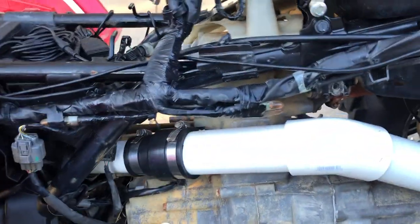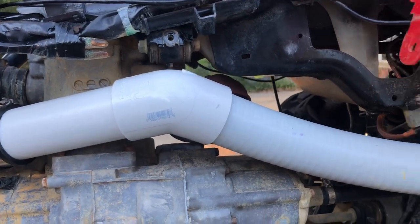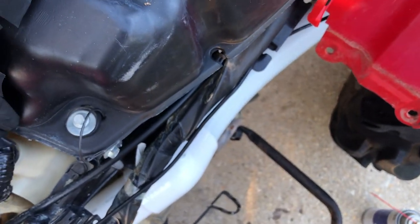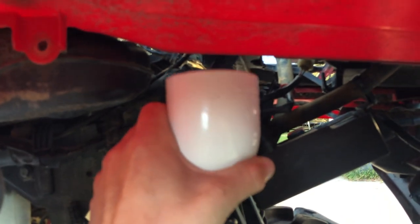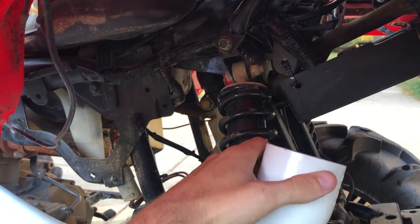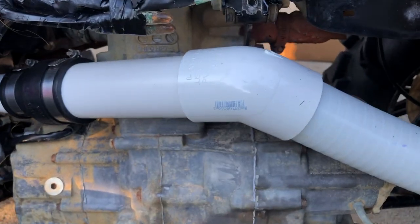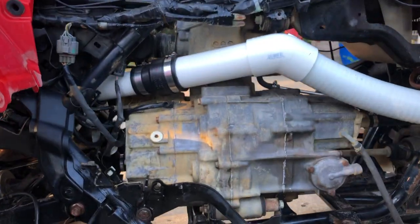So this is where I'm at right now. I go from 1.5-inch to 2-inch to my 45, and I'm bending this flex hose so it curves in along with the plastic and then runs up here. I just need to figure out where I want to drill the hole in the plastic to bring it up, and then figure out a bracket or the easiest way to mount it. The only thing you have to glue together would be this coupler, that coupler, and your tall piece coming out the side — and that was it. Super simple to put together for sure.